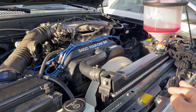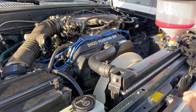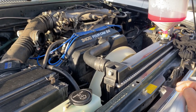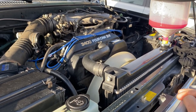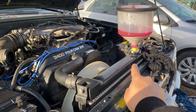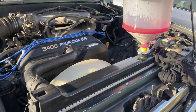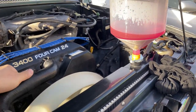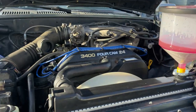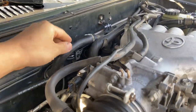The engine is at regular temperature and I'm trying to figure out why it's not getting any heat at all — it's really weird. I'm not sure if it's going to accept any more coolant; I think this might be the max, so I might close up the cap and see if it makes any difference for heat. There's still a little bit of bubbling here and there every time I press the hose. Every time I press it, a few bubbles go out — these two heater core hoses right here are really important.